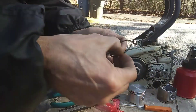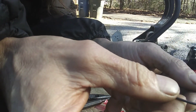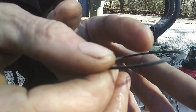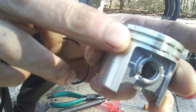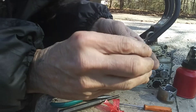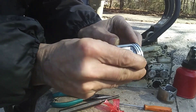Now, these rings — they're the same ring, so it doesn't matter which one goes where. But it does matter: there's a bevel on these. You want the bevel going up, so the angle going down. You want to put it on like this because there are little stoppers, or pins, or nipples, or whatever you want to call them, in these grooves that this is going to align to when you put it on. Just work these around gently — start in the top ring, top groove, and go around.